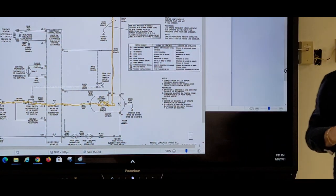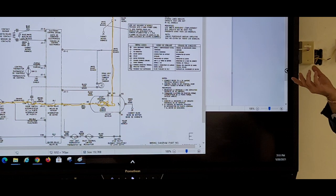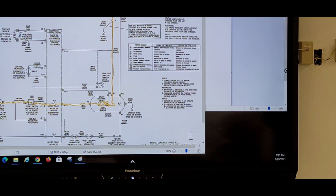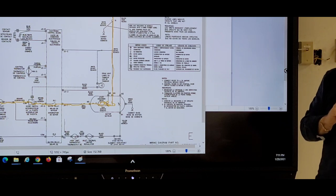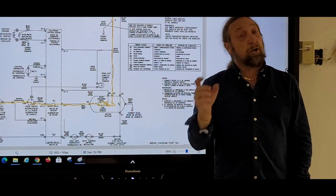So now you're looking at the door switch. Right? But it's not that fuse. We know that for a fact, right? Because the board lights up. So we need to check the door switch. Let's go back to the computer board. Give me one way you would check the door switch and where you would put your meter leads.